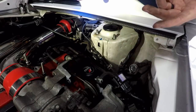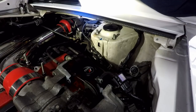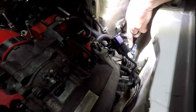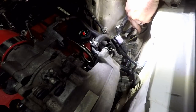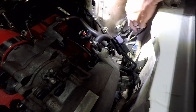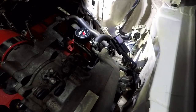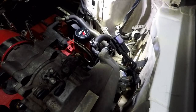But now we have all this wiring and stuff. I see a horn down here which I don't know why there's a horn in the back of the car - that doesn't make much sense. So I might remove that too. This might be a lot bigger project than I thought it was going to be. Why there's a horn in the trunk - or in the engine bay of this car - I keep calling it the trunk, I'm still not used to these kind of cars. I'm going to go ahead and remove this too. I'll just put Hella horns up front because you can't see them anyways. Once I remove that, since this wiring is for the cruise control, I can now get rid of all this wiring - tuck it up and out of the way, and it'll make this whole area look a lot cleaner.